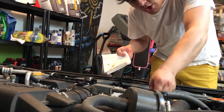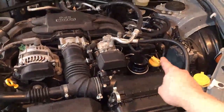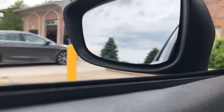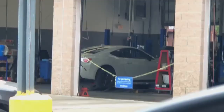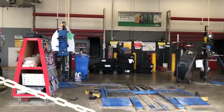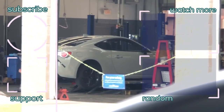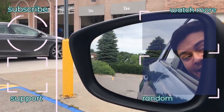That is the healthy oil level of this engine — right in between those two dots. And there you have it. Replacing that old oil filter with the new one is pretty easy and relatively pain free and not messy if you know what you're doing, especially with the FRS engine. It's a general rule of thumb that a lot of us car people struggle with if we're trying to save a quick buck — you really have to spend the extra 10 or 15 dollars sometimes to get the OEM parts to make this engine last longer. Pretty much applies with any car. I can't guarantee this fix is going to be clean on every car, as oil filters can be below the engines at times, which will spread a lot more oil when you remove it, so be careful. And before I go — happy 86 Day, everybody. I got some new wheels and tires and they're pretty freaking amazing. I would love to share them with you but I need to save that for another day. Thank you so much for watching, and I hope this video helped someone out there.